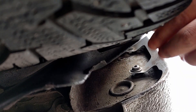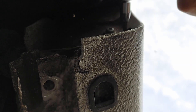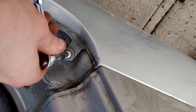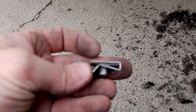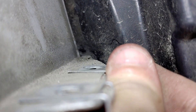If you're doing this to your car, I suggest you hold the side skirt flush to the car where you want it before you put these screws in. These screws have a lot of movement and play in them, so you can adjust the body panel gaps — basically take your time and make it look how you want it. These happen to be the only parts in this process that aren't directly screwed into the car. They're clamps that hold the side skirt to the fender panel, and you can put a screw through them just like this. You may have to go by feel for this part, but you'll get it eventually.